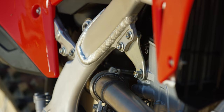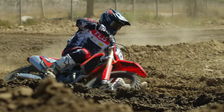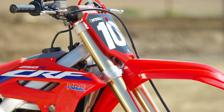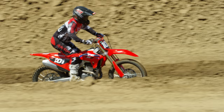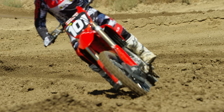It really comes down to setup and chassis. Initially, rolling into some high-speed blue groove hard-pack berms, it almost felt like the front end was diving in a little deep and then wanting to deflect. We tried going two clicks stiffer on compression on the fork, but then I lost that nice plush absorption on the bumps. So we went back out and tried sliding the forks down in the triple clamp — only one millimeter. The Showa tech pointed out that it kept the front end a little taller so I didn't have that divey feel in the turns.